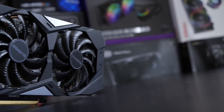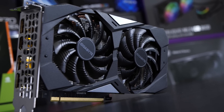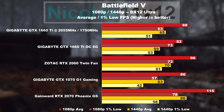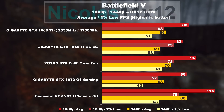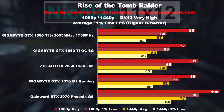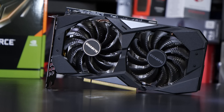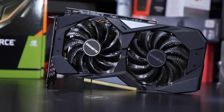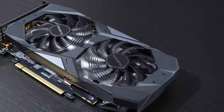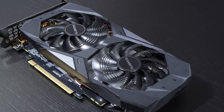You shouldn't have your hopes up too high — it's wiser to be content with the gains we're already getting. More is only a nice bonus. Although in a couple of games like Battlefield V, after overclocking we do see slightly worse 1% lows. There are similar symptoms in Rise of the Tomb Raider. I may have pushed my overclock a bit too far and might need to lower the GPU and/or memory clock slightly. But most games actually do show good improvements when it comes to the 1% low minimum. And in hours of testing, I didn't encounter any stability issues — none.